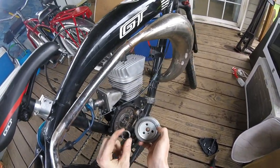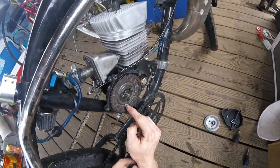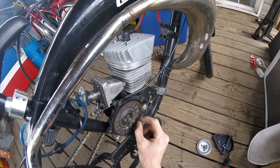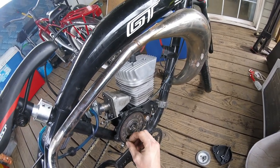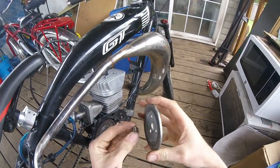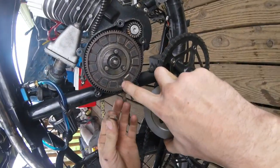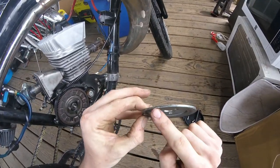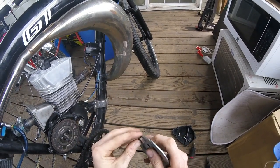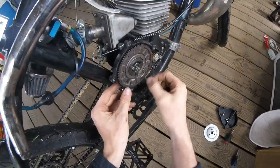Turn the flower nut out by hand - it's really not that hard when your clutch is pulled in. Take your flower nut off and this opens up your pressure plate. Now you can see all the clutch pads in here. Someone asked about how to remove them - some clutch pads are pretty stuck and some are really loose. I prefer mine to be loose because your pressure plate here pushes on your pad and the back side of your pad needs to push up against the metal on the inside - making two contact points instead of just one off the pressure plate.